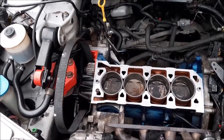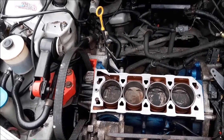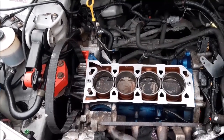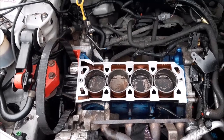And I think they say sometimes you shouldn't have a cam belt any older than 7, at the longest 10 years old. Normally change it at 7 years. So we think with all this work, we might as well change it as well. So we'll take you through that process when we come to change it. But now it'll be cleaning up the head.